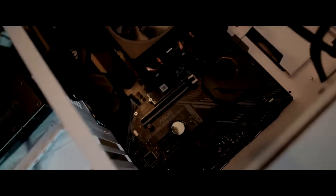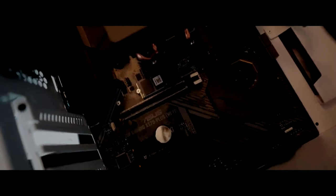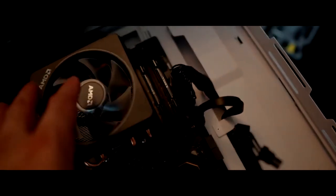The PC was fully built and then it wasn't turning on, so I wanted to let all my gamers and PC builders out there know that if they just built their PC and it's not turning on, here are a few things to check: Make sure your RAM sticks are securely in. Make sure your CPU socket is securely locked — with AMD there's a lever you want to make sure you switch. Make sure you use the 4-pin connector for your motherboard and have that securely plugged in. One of the big things I just realized I was doing wrong was my power negative, power positive, power switch for the case was wrong — make sure that's right so your PC can turn on.